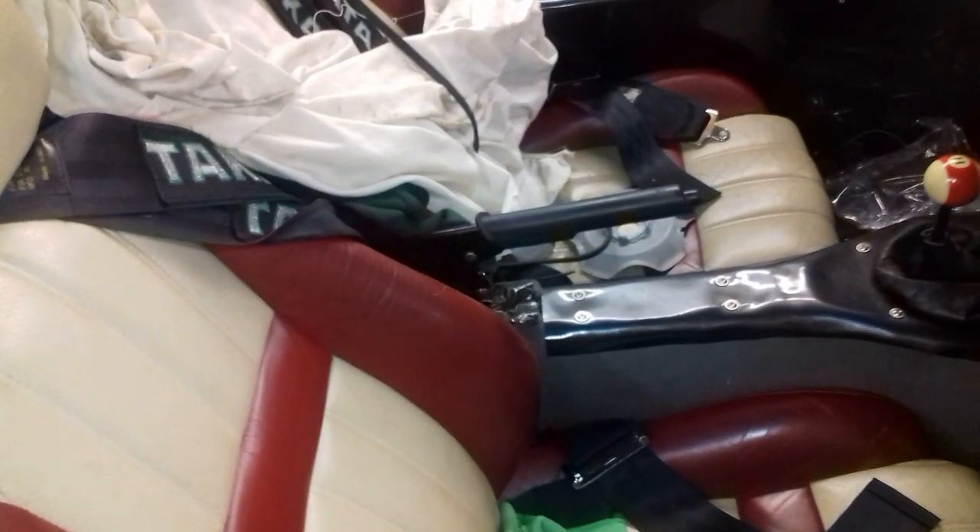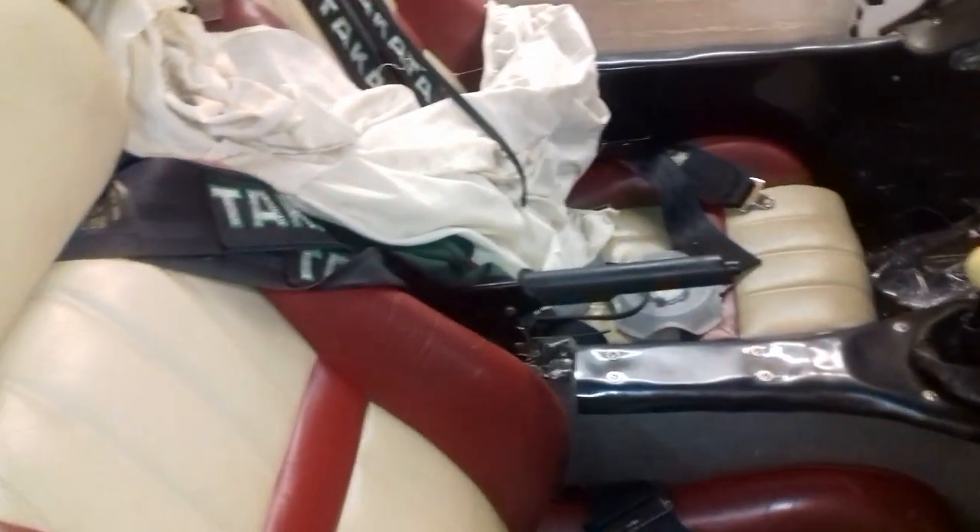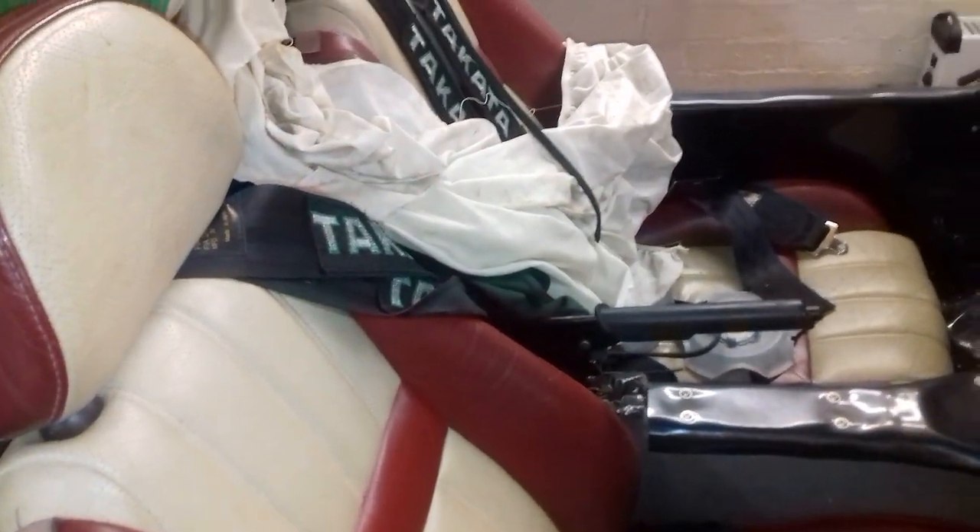That's the front done. The brakes are done — the foot pedal's great. Handbrake goes up and down but it feels like it's under a bit of tension. It's not binding on the drums, so I might have to take the drums off and see what's going on in there. It probably just needs adjusting — I thought it was self-adjusting but maybe it's not.